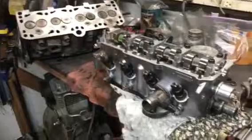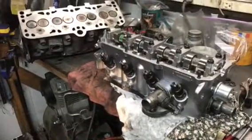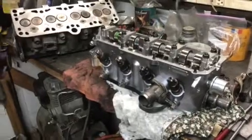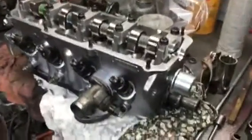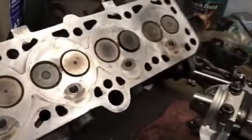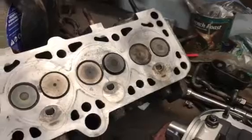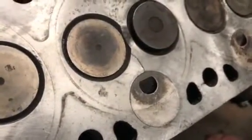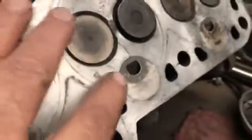Now I've got a cracked head and nine hundred dollars worth of parts and eight hours of my labor because I was too impatient to warm these motors up. Most guys drive fuel-injected gas motors nowadays and they don't have this problem — most of those are designed for that. This little motor is not. So needless to say I'm going back to my original practice of letting these motors warm up.